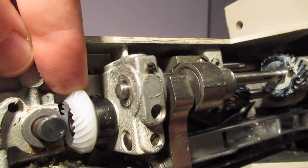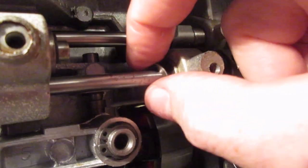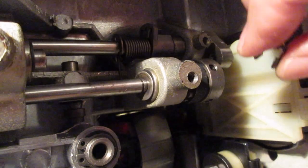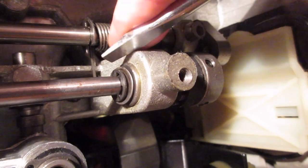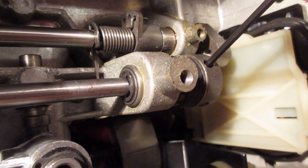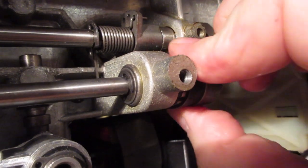I did get it to work - at least it sewed, though I'm not sure if it's optimal. I've already replaced the other two gears, and now I've got the shaft undone. I'm going to stick this keeper ring on here to reinstall the shaft so it doesn't slide anymore. You have to take that off to get the gear on there, and you even have to take the power supply off to get the other gear set installed, which I'm not showing here.